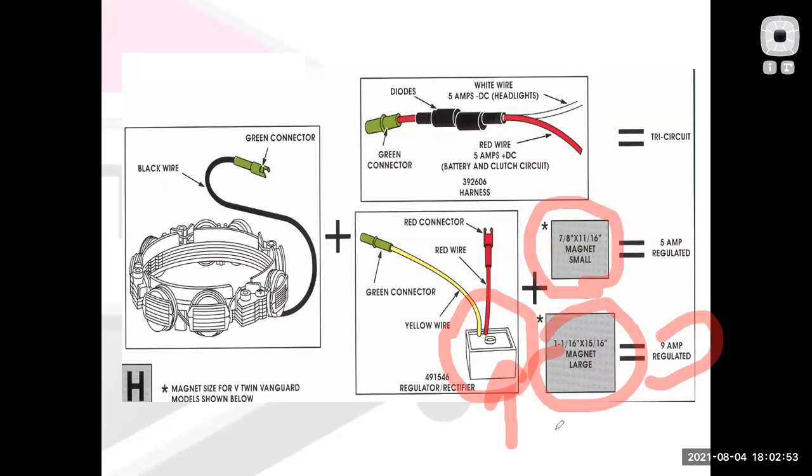Now, that little box is typically going to be built into the alternator of a car. Really old cars had a voltage regulator that was external, a little metal box. And really new cars actually let the computer that controls the car, the engine control module, usually take care of this function.